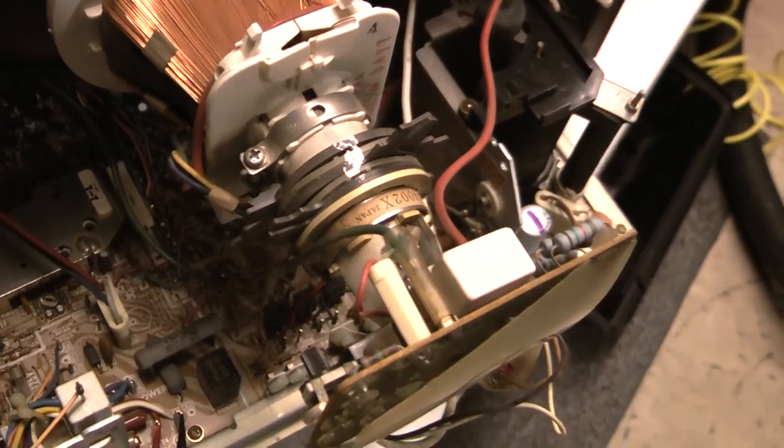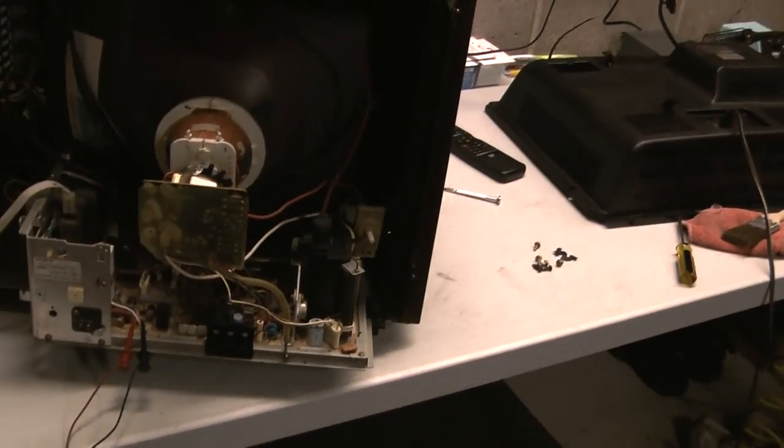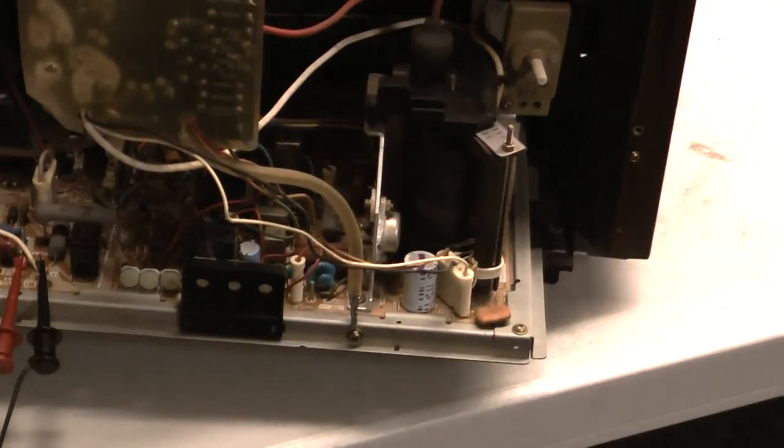There's the tinging I was talking about. We are live. There's the white line. The camera's making it look a little bluish, but I got a perfect grayscale now. That was easy. TV looks great. Focus didn't have to touch. It's razor sharp all around, you can see all the scan lines. So yeah, just a little tweaking on the bias. And the screen control is right where it needed to be, actually, using the setup line. Everything else just needed a little tweaking, and it's perfect now.